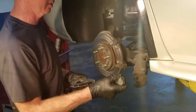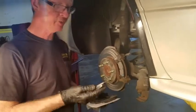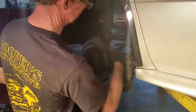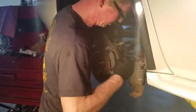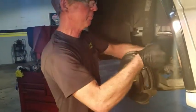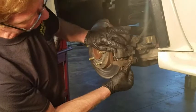The blue is the outer pad. Your red is your inner pad. Got those clipped in. You put the outer pad on the outside — just hold your hardware in place. You've already lubed the pins. Slide the caliper on and rotate it down. Push that little adjuster back so it gets down in the slot — there you are.